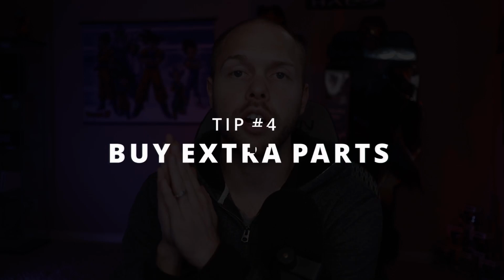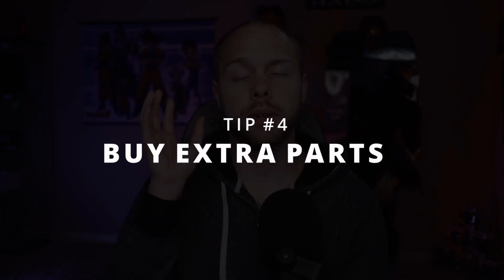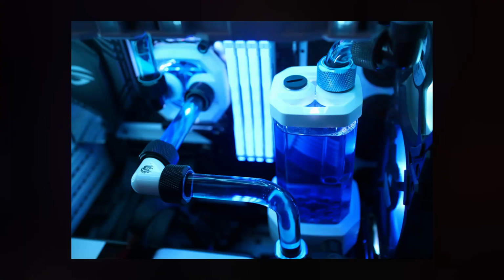Tip number four, we're talking about the tools that you need, and I'm gonna start with this. Buy extra of everything and return what you don't use. I only had a plan A for my ideal situation, so I bought just enough fittings. And of course, we get in there and we could not pull off that double 90-degree bend from the pump res combo into the CPU water cooling block. I had to make a trip all the way out to Micro Center just to pick up that 90-degree fitting. Just go ahead and buy extra of all your fittings and all of your tubing.